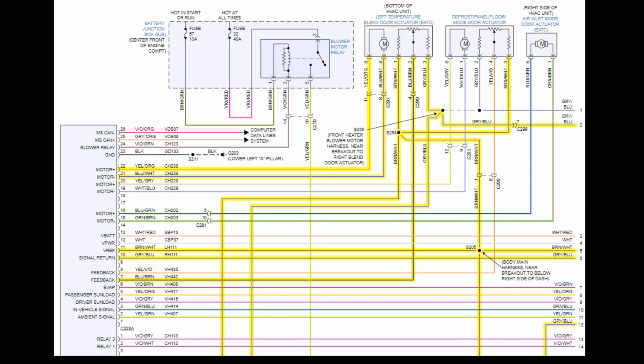So looking at the diagram, again, let's say hypothetically this stuff's not covered with us, right? They don't give it to us. A lot of our diagrams, they don't. Can you tell me what the 5-volt reference and the ground is on this circuit? Well, it's pretty tough. I can see a splice here and I see a splice here. So I know those two are my 5-volt reference and ground.